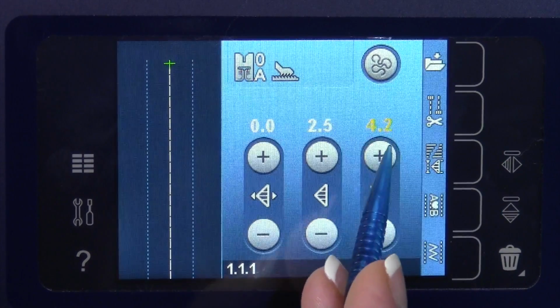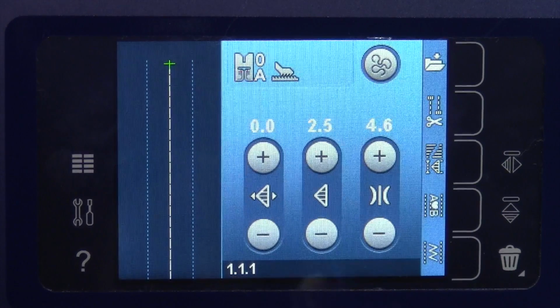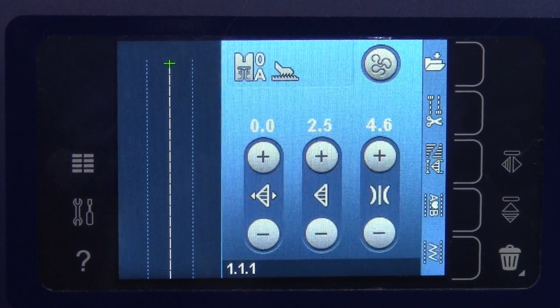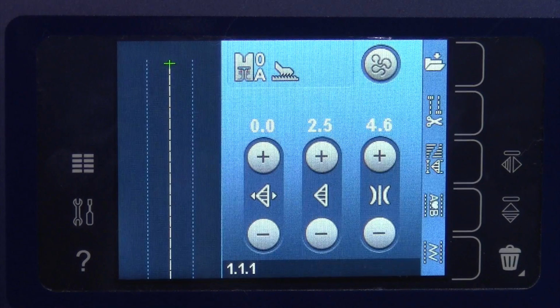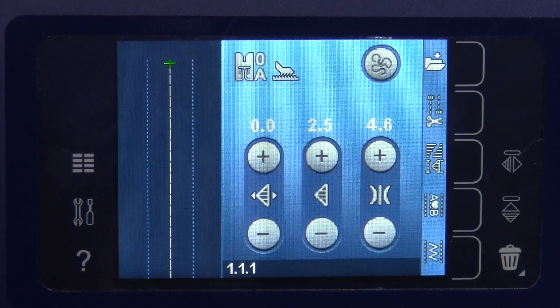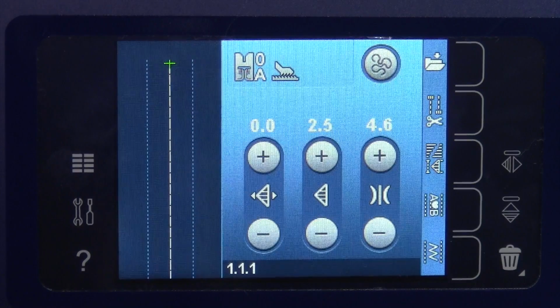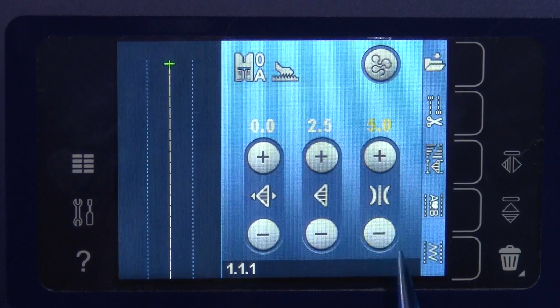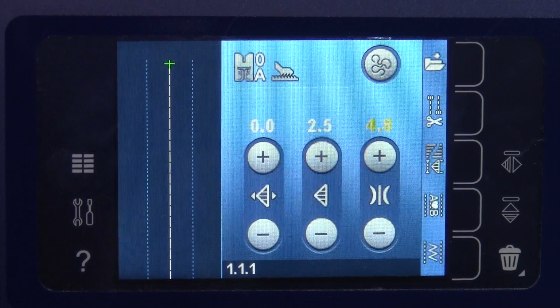So before you start changing tension all the way around, make sure all your other settings are correct. Have you cleaned the machine? Has the machine been in for an annual service? All those things are going to make a difference because wear and tear on your machine and all the lint from those fabrics, they're going to make a difference. And if you can't remember if you make it tighter or looser, one is going to make it better and one is going to make it worse.